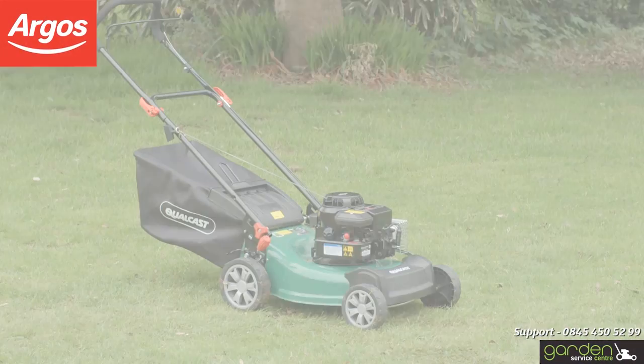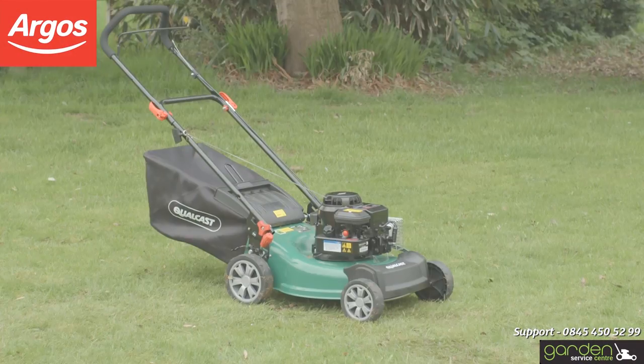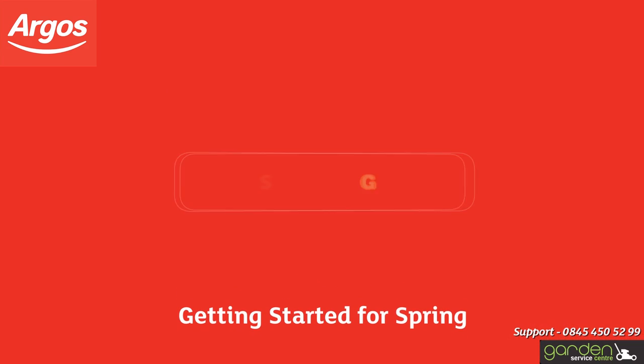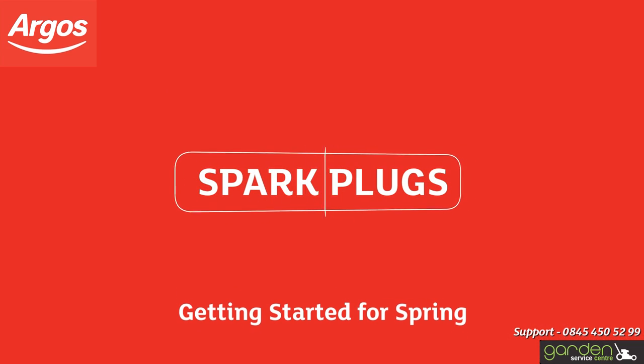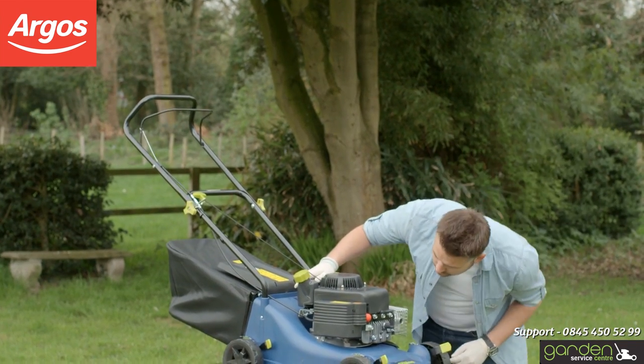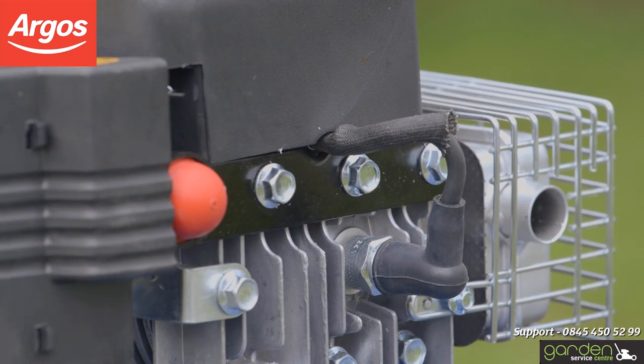If you're having trouble with your petrol mower this spring, we've got some helpful tips to help get you going. One of the most common issues after a winter in the shed is that the spark plug may need cleaning or replacing. To check your spark plug, firstly, locate the cap that covers the spark plug.